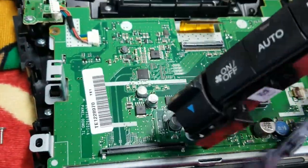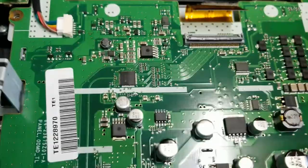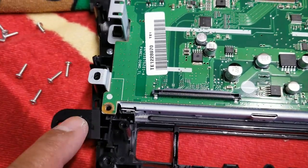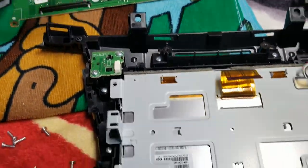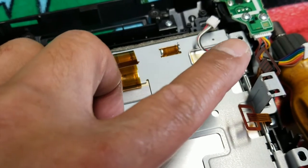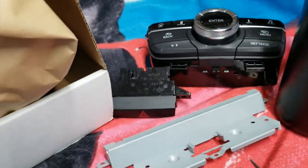And you have to remove this guy with the button and the rubber. These just all pop back in. It's a Honda — it always goes back. But you have to be gentle. And whoever the hell designed this thing should be maybe just punching the face. So now that we've released this guy — screws, people: one, two, three, four, and five. Gently, Wesley. After all the ribbon cables are out. This guy also had four screws. I'm losing count here — I should videotape before I do this. All the screws are the same, except for these two, which hold that and the hazard button. So everything else is the same screws, so even if you start taking them out it doesn't really matter where they go.